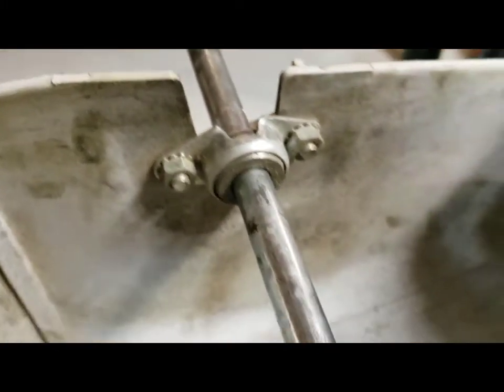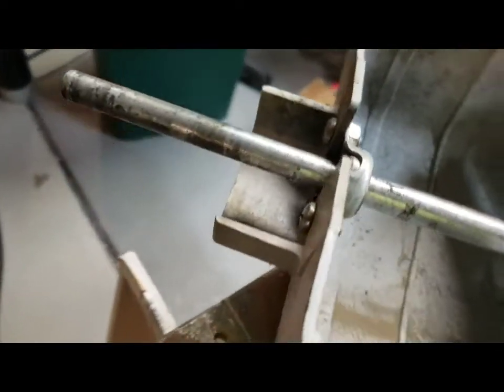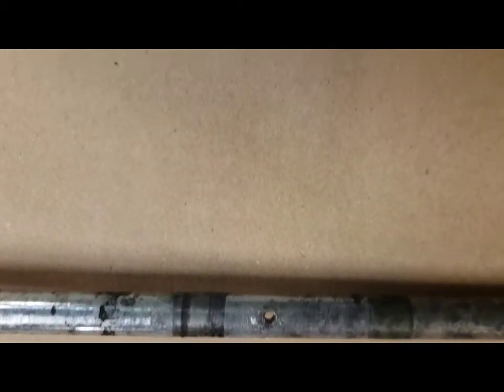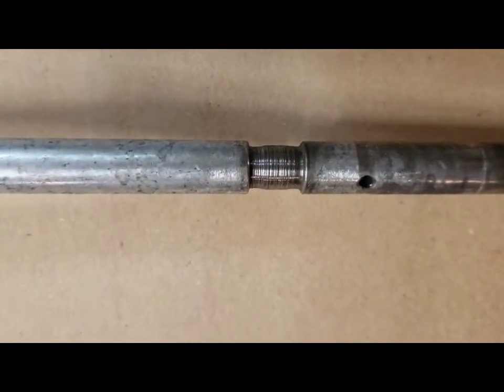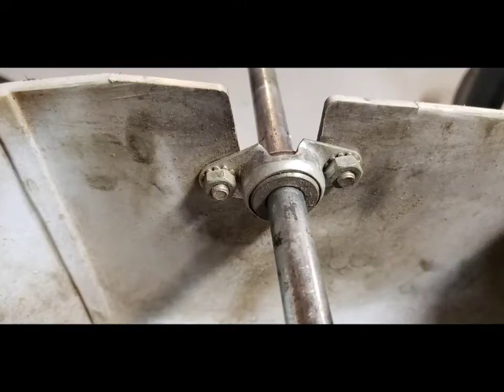Now there's the mounting bearing. Those mounting bearings wear out — there are only two bolts holding them in, so they're easy to change. Best way to do it is to slide the axle back. Here's a look at what a worn axle looks like versus a good axle. That's the good axle, and there is a worn axle — that's from letting that mounting bearing get too worn. It starts to eat away at the axle and eventually it'll just break, and then you'll need a new axle as well. That mounting bearing is dirt cheap, only costs a few bucks, so keep some on hand if you're going to maintain your own cart.